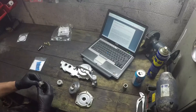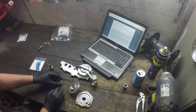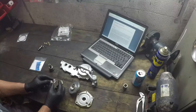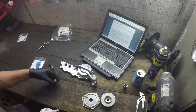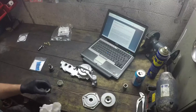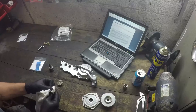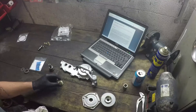Basically we're trying to avoid the axial play and the in-and-out play from this ring that sits inside. What we're going to do is replace this ring for another ring that's a bit thicker, I believe. These different parts are all parts of the bearing system itself, so I want to take these off in order and keep them in order, give them all a wipe up.